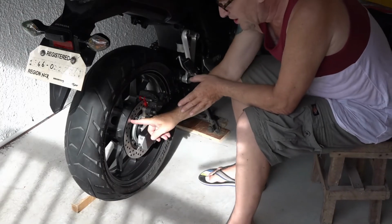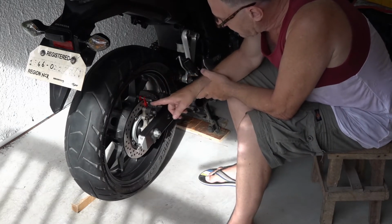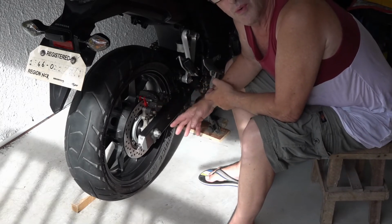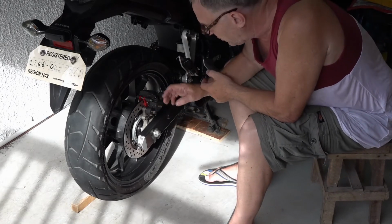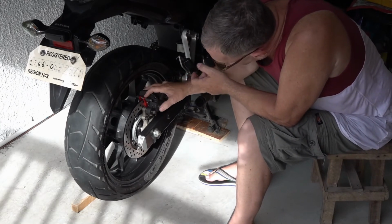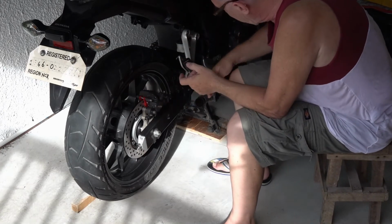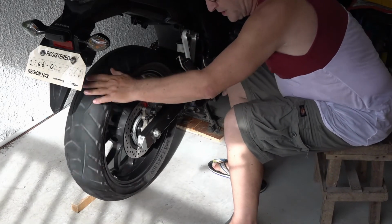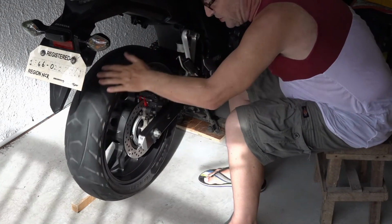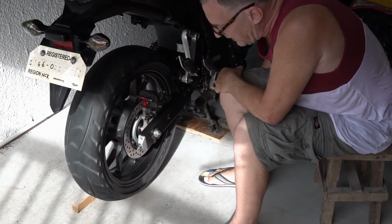So now the rotor, the pads, the calipers are all torqued, everything's set to go, and we want to test to make sure that the pads are properly in the spring clips and nothing's dragging. So we'll spin the wheel and hit the brake, okay? And when we let go, the wheel should spin freely. It shouldn't really drag. It might drag here and there in spots.